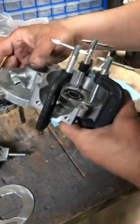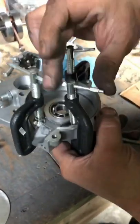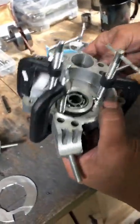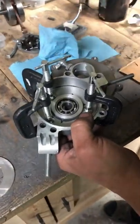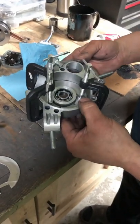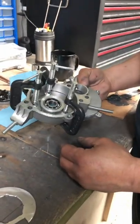Just a slight pressure on it like that. See how it's squishing out just slightly here? That's kind of what you want — squishing out a little bit means it's going down nicely. That one's a little loose, tighten it up a bit more. Spreading it on really thin will make sure the plate doesn't sit too high and start rubbing against the crank. It should be really close to our dry fit — once we put it back together it shouldn't be rubbing at all.